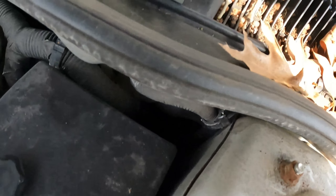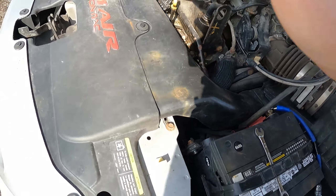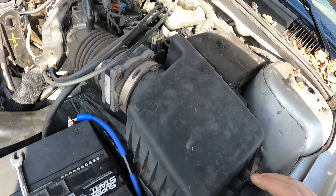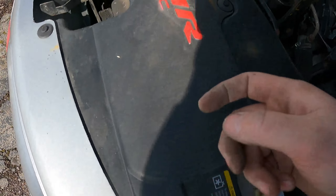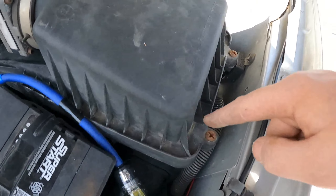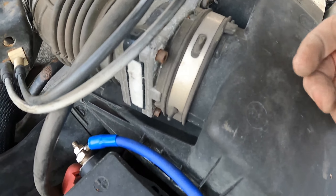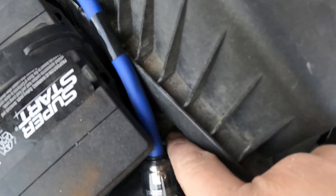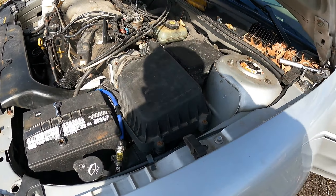Getting down behind here, the only good way is to rip out the air box and the ram air and slide this guy forward. I have a few other videos describing that, but real quick: push pins out, that comes out, a couple screws, pick one of the clamps, undo it and pull that out. If your box still has it, there should be a 10mm there and there will be one right between the battery and that. Then that bottom will come out. I'll do that real quick and then we'll come back to the fuse box.